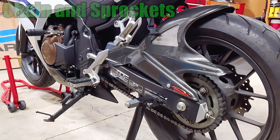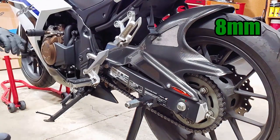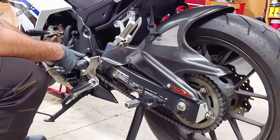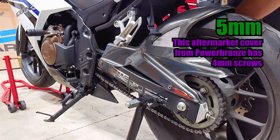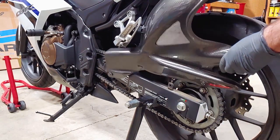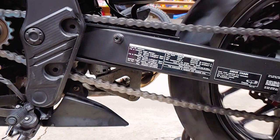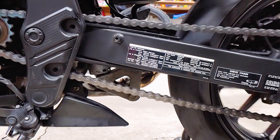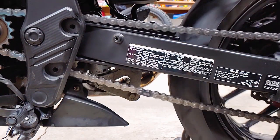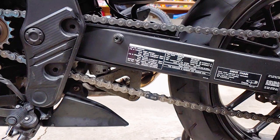Next we'll take a look at the chain. I only removed the chain cover so you could see everything better — if you want to remove it, you have to remove the footpeg with an 8mm hex first. The factory chain cover is held on with two 5mm screws. We'll start by checking for binding links, which can cause tight spots in the chain and usually indicate that dirt has gotten inside the sealed portion of the link, in which case the chain and sprockets would need to be replaced. Always replace the chain and sprockets as a set, or things will wear out much faster. You might have noticed that my chain has a removable master link, which is not recommended on bikes 500cc and up because the link could come apart at high speeds — I installed the chain before I knew this, so it's something I'll need to take care of.